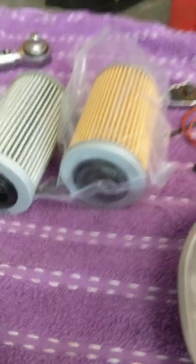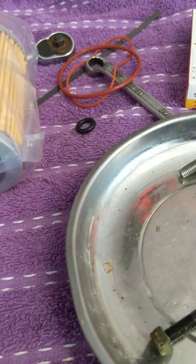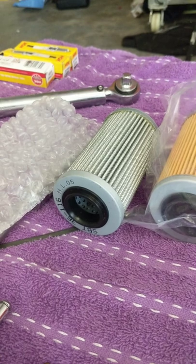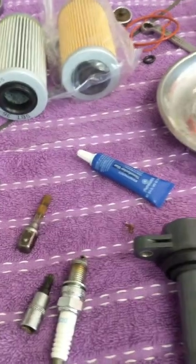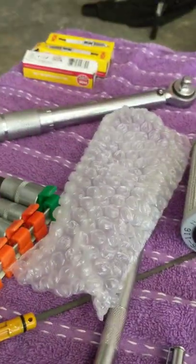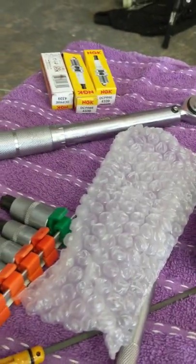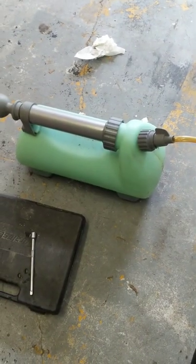There are two oil filters — I'm going to use the 1503, but that is a 300 oil filter. You always want to replace the old O-rings, it's just the thing to do. I have my torque wrench — I like to follow the specs listed — and always use a little bit of blue thread locker. I already had set out the spark plugs for the 300 with the oil filter, but I also have the 1503s. A couple other tools help with the job but it's relatively simple. Last but not least, you're going to need your trusty oil extractor.